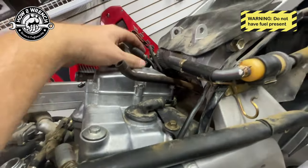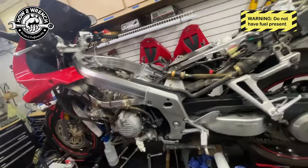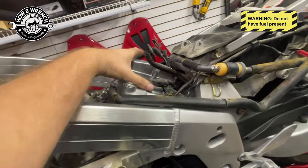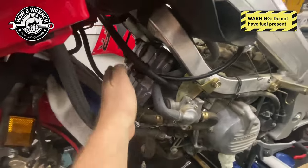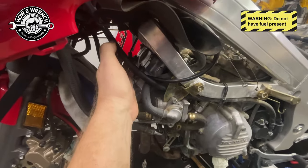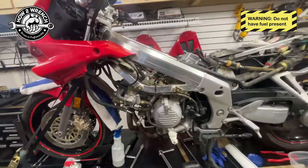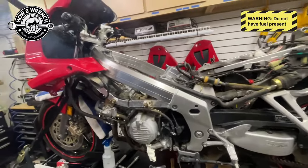These are great times to take advantage. In the case of these ignition coils, you can see they're buried back down in here. If I had the gas tank and everything on and then found out something's not right or it's not running well — maybe a spark problem — I'd be doing a ton of reverse work. So I'm doing that spark check right now on all of them. Once I put that radiator on, that is a knuckle-buster. In the manual they actually have you loosen the mounts and tip it forward just to get a little access in there.